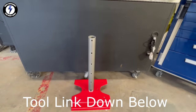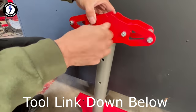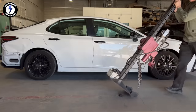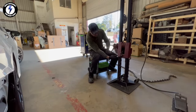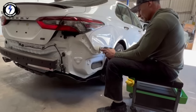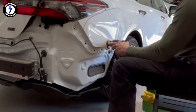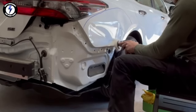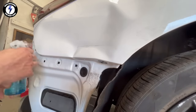Now I'm setting up two dent towers, adjusting the pulling height to match the damage. I'm going to clean the panel using a wool pad in the corner on the edge, just above where the bumper cover sits. Now I'm working towards the wheel — this step is really important; you don't want your glue and tabs coming off in the pulling process. Squirting alcohol on the panel and giving it a final wipe down.